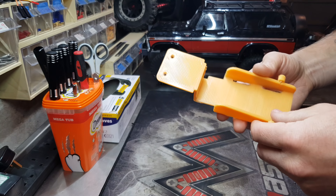I'll make sure I'm lifting it so the suspension is fully retracted. 33 is just okay — let's try 34. That's all right. Let's try 35. I'll do a little bit more — 37 is too much. So I'm going to say 35 degrees maximum with the stock tray for the side angle.